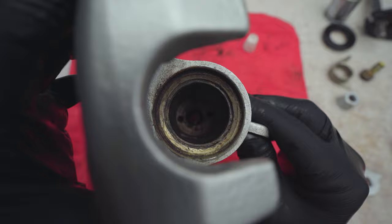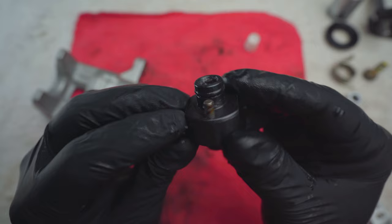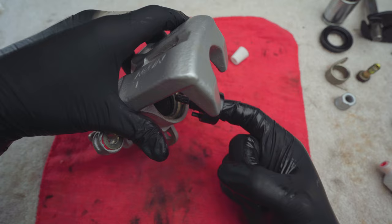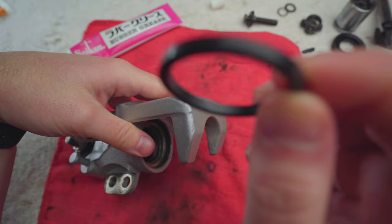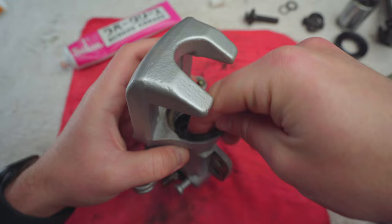Here's a look at where the next part we need to install will be seated — you see those two pins. There's also an o-ring there that needs to be replaced, which I've already done. I took some rubber grease and put it in that hole there, then you put that pill-shaped piece in there. I was able to get my pointer finger on the hole on the back side to guide it in. Once it's in you'll be able to tell it's seated if you can't turn it back and forth. Next up we have this square cut o-ring to install. You'll be able to see at the entrance where the piston goes there's a pretty big channel — make sure that is as clean as you can get it and work on getting this thing in. It shouldn't take too much effort to get it seated.